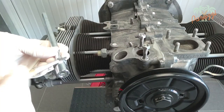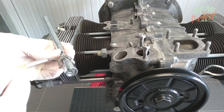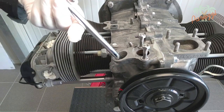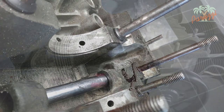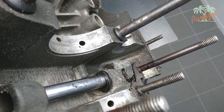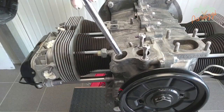Ideally, the diameter of the rod should be just a little smaller than the bore at the bottom of the crankcase, so that you can center the shims. Use grease on the shims so that they will later remain in place in the crankcase. Position the rod centrally and drop the shims into the crankcase. Check that the rod is properly centered, and pull it back out of the crankcase. Note that if not centered, the shims may fall into the crankcase when you install the drive shaft.